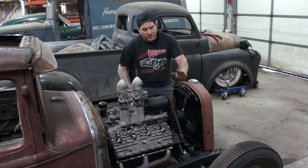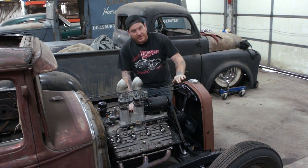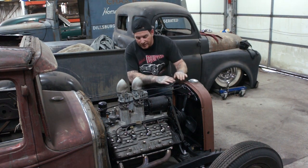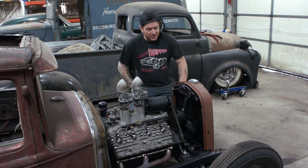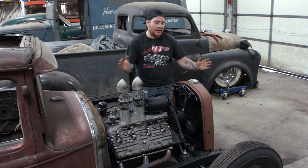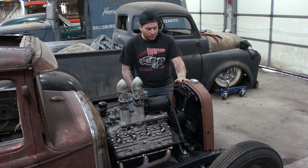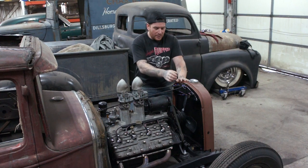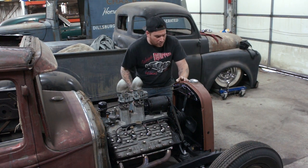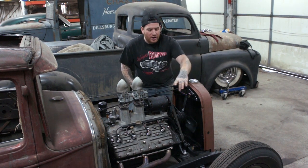So what I decided was to use a Model A top tank. The Model A top tank doesn't dip down quite as far, which gives you just enough room to put two outlets right here so they come out and evenly go right to the heads. The problem with the Model A top tank is that because it doesn't have that steep curvature, it doesn't allow you to sit the grille all the way in on the radiator like you would with a 32 radiator. I decided to compromise and set the grille shell — or radiator, however you want to look at it — back. Really all it did was it's maybe an inch and a half or so that's sticking out more than it would have originally, and it kind of lines up nicely with how the support bars are here.